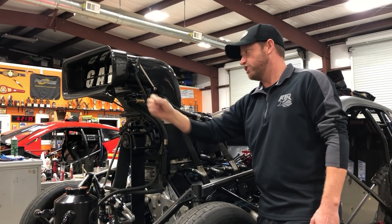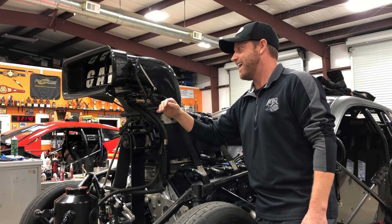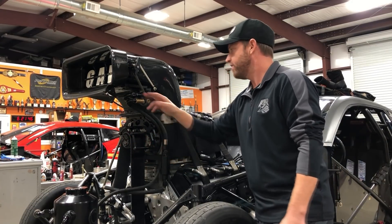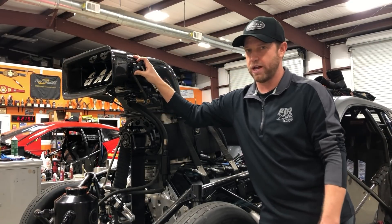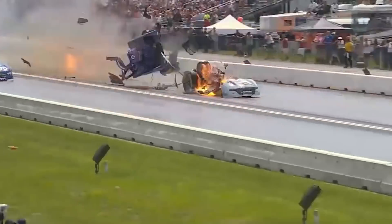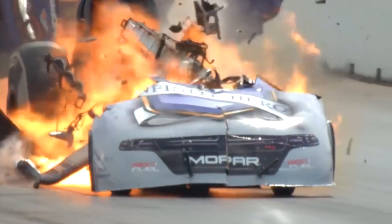This is the outlet of the barrel valve. When the driver slams the throttle, this opens up and completely opens a hose that goes to the flow meter. This is not a half-throttle means half the fuel situation — it's pretty much on or off. If you drive one of these cars at three-quarter throttle going on the track and hold it there, you're probably going to tear the engine up because you will not have the barrel valve all the way open.